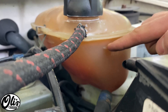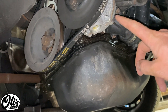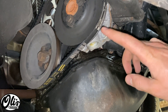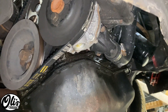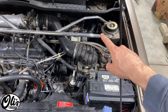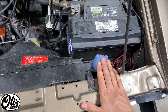Open the hood and make sure your coolant is between your min and your max. Then underneath the vehicle, make sure that you still have your water pump belt on the water pump. You can see the belt is here and it's pretty tight, which indicates the water pump most likely isn't the issue. Also look to make sure there's no coolant leaking. You never want to open the radiator cap when it's hot because it will boil over and burn you.